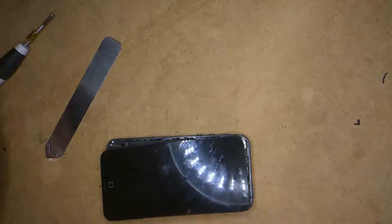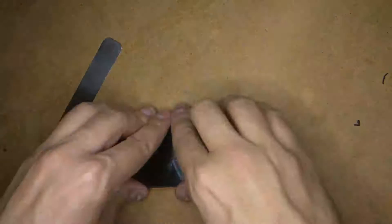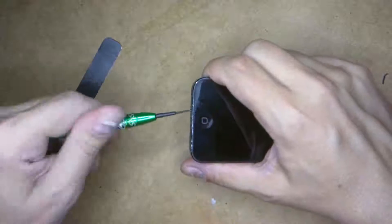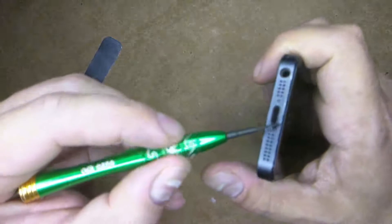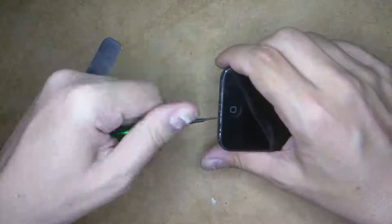Finally you just have to make sure that you turn everything on and test it. When you do test it, remember that the rear housing comes with a new charging port, audio jack, mute button, and volume button — so you need to test all of them to make sure they work. Once they do, you can close and secure everything, put the SIM card tray in, and that's all done. Thank you for watching. If you like this video, hit the like button below. If you have any questions, feel free to drop a comment below, and please subscribe as I'm going to have more tips and tutorials.